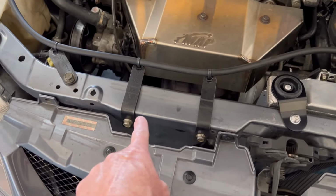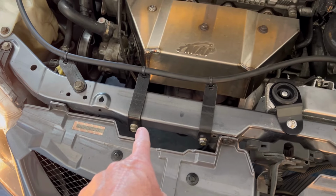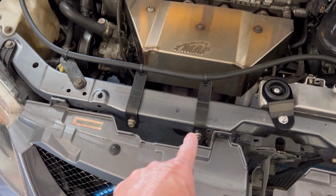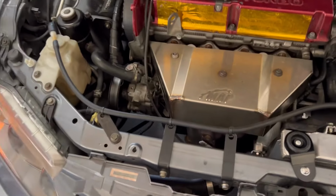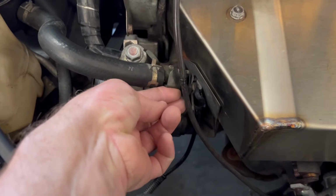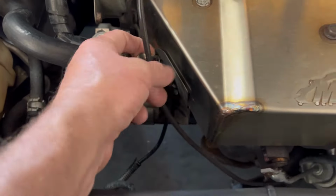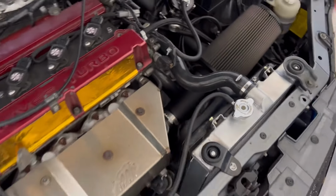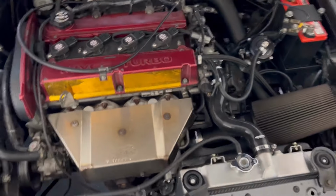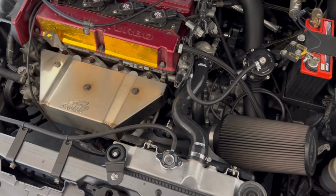These two holes are essentially the pusher fan for the AC system, and that's the original radiator bracket hole. So all of those are pre-threaded, so you can actually use the original hardware. Routed that over. I kind of had another bracket I had laying around to keep the O2 sensor off the manifold. But everything seems to work properly. I went for a couple 100-mile trip yesterday.